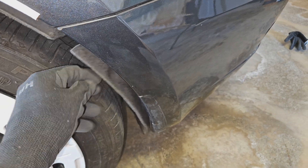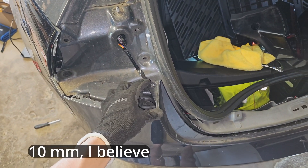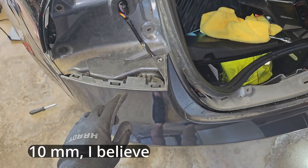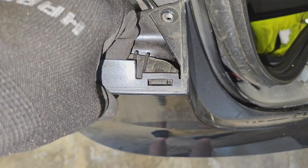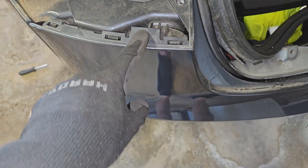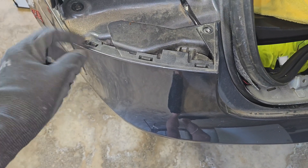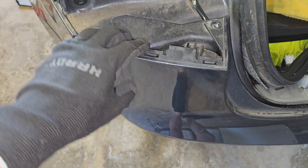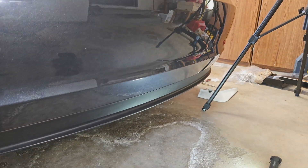Once these are loose on both sides, it's time to work on the bumper. We already got the tail lights removed and we already removed this bolt as well. Remember when pulling this off, it sits on these little clips right here — you're going to have to pull the bumper over the clips. These three clips: the plastic bumper has to just go over them because these clips are also holding it in. Now we're going to go underneath the bumper.